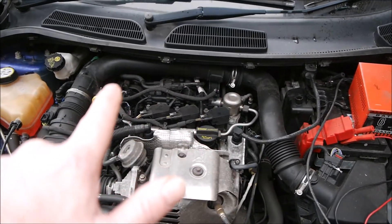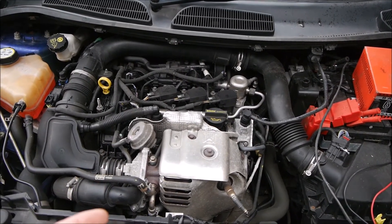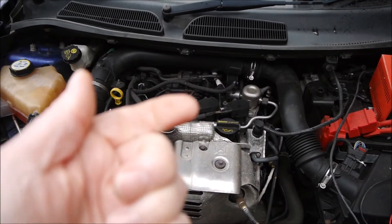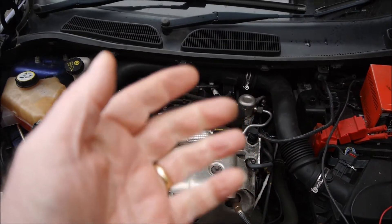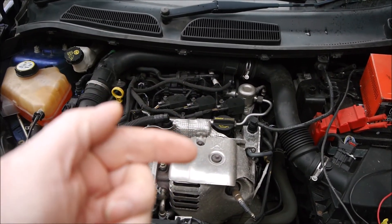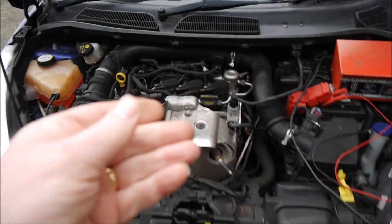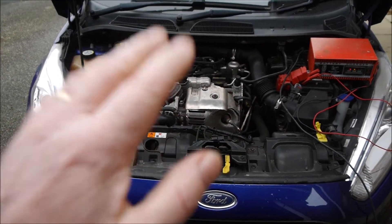My theory is to strip the top of the engine down, have a look at the cams and see if they look worn, get it in the garage on the ramps, get the sump off, drain the oil out, and look for any metal particles in the oil - if we've got that then that's a thumbs down. The oil pump's going to be blocked for sure as that's the cause of the problem. We'll take the baffle plate off, take the big ends and main bearings off, look for damage, assess the top and bottom, look at the quality of the oil, and take it from there. If it's completely had it, it gets a new engine.